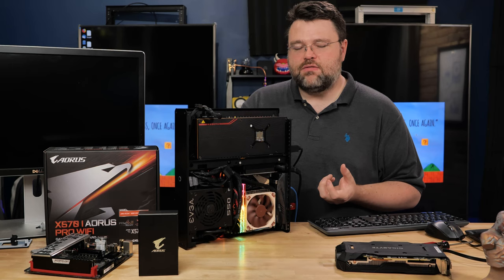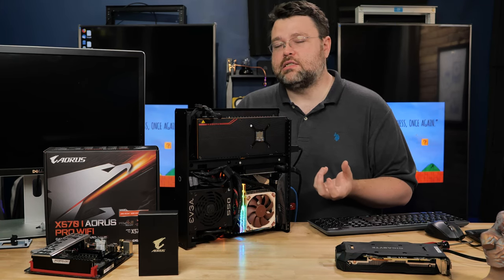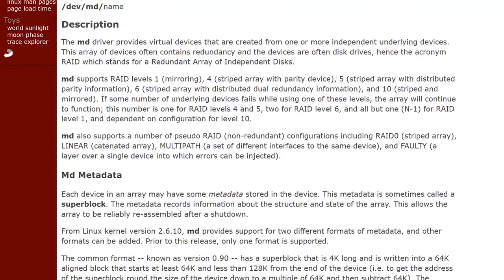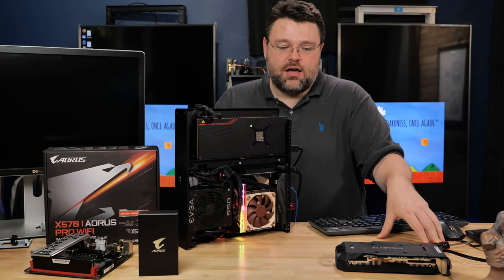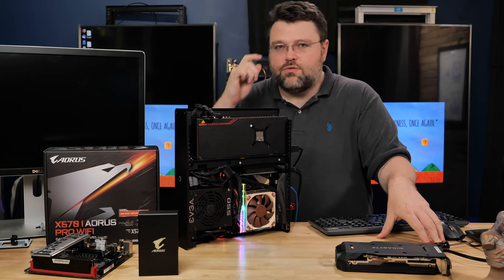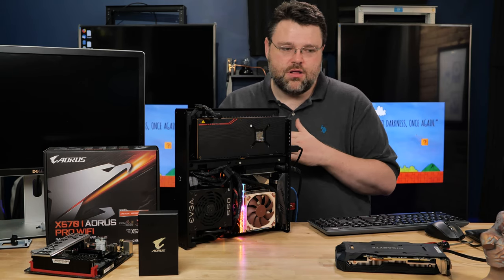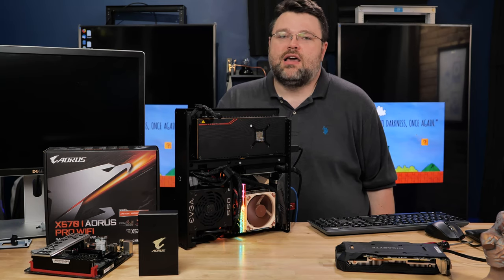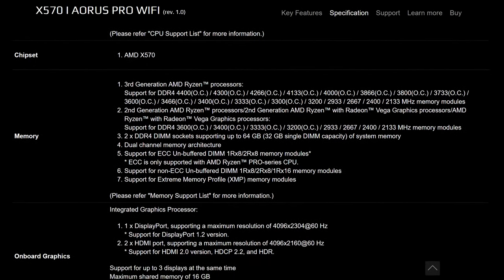Now I can run RAID 0 or RAID 1 of NVMe — I'm not really sure about that on the AMD side of things. On the Linux side it's not going to be any problem because I can just use Linux MD multi-disk, and that's what I'd recommend if you're looking into doing this. Those PCI Express 4 SSDs — if you're doing something like a giant unruly Node.js project with a billion tiny files, these particular SSDs handle that workload really well.